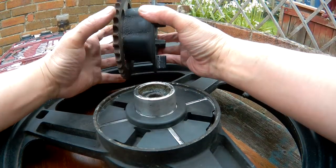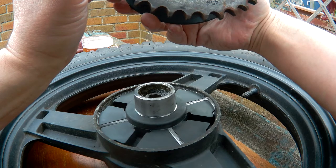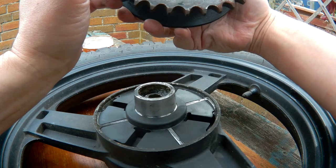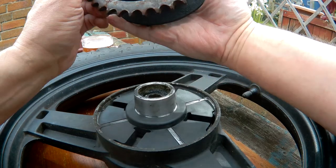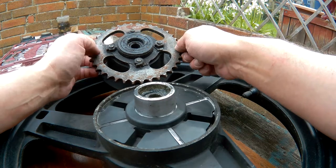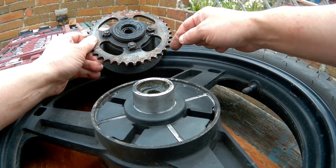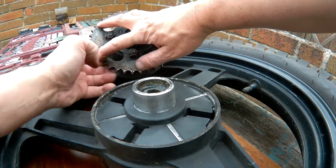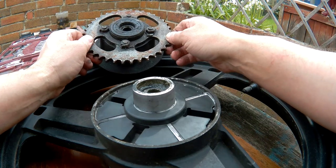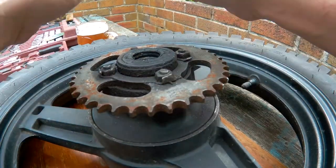While the wheel's off I'll be cleaning up all the oil and scrubbing this down. This could probably do with replacing - it's got notches on it. It's marked 4-8, 38T - I suspect 38T is the number of teeth. One, two, three... yep, 38 teeth. I'll probably see if I can get a genuine Suzuki one if it's the same part.